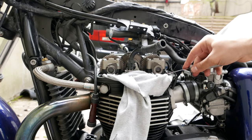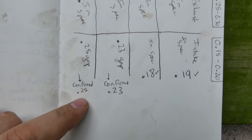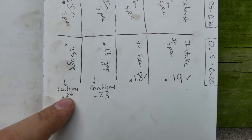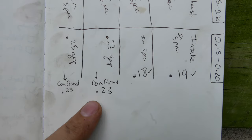Repeat this process for both sides of your motorcycle. After I measured all my clearances, I found that two were out of spec and they were both on the intake side. So the next part of the process was to figure out what size my current shims were, so I had to remove the intake camshaft.